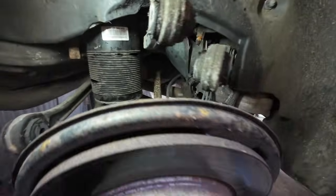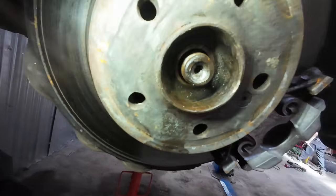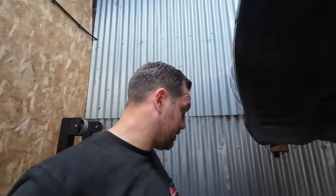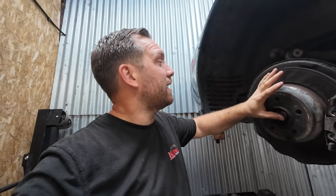I'm at the stage where I've taken a few of the arms out to lever the whole hub down, but this driveshaft is not coming out. Tried a bit of heat and the hammer, but it's quite corroded in there. Next option would be to take the whole hub assembly out and push it through, or borrow an air hammer from someone down the road. That was a bit of a fail - the other guy wasn't in his garage. Got to come up with another plan, but for now I've got two more jobs to go and do.